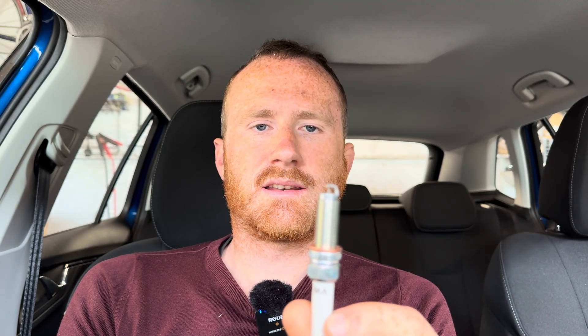So what does that mean? Well, in a spark plug like this we have a ground strap and then we have the central electrode, and the spark obviously goes between those two bits and ignites the fuel-air mixture. But in a modern engine with direct injection, if the ground strap is in the way of the injector, you'll get a poor spray pattern and possibly a misfire. So in race engines, people have always been interested in clocking these plugs so that the ground strap sits in the optimum position.